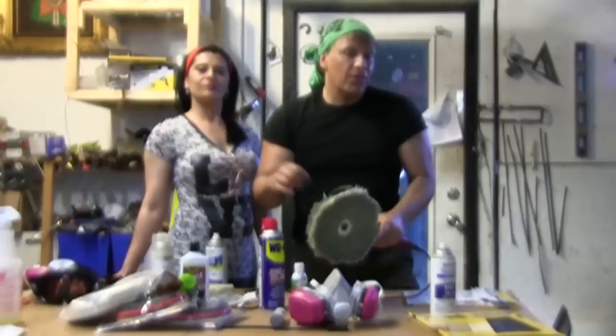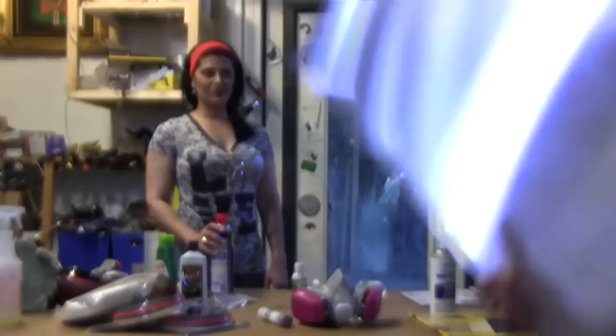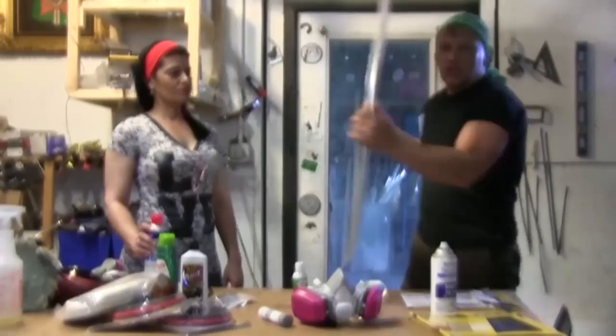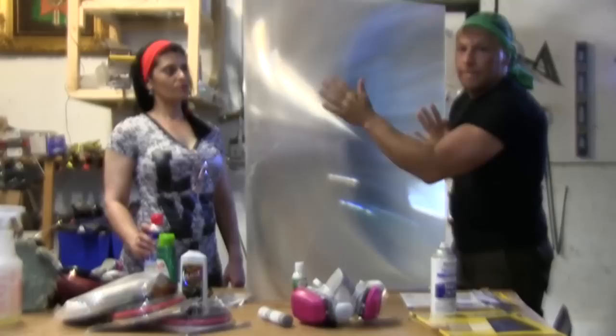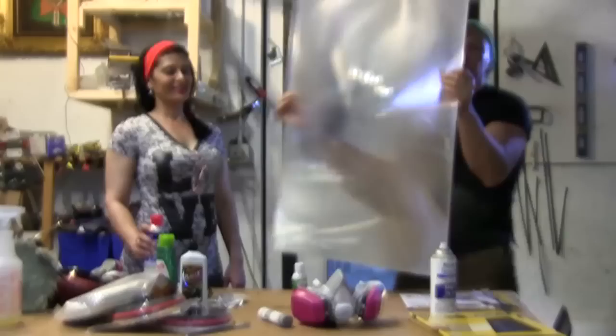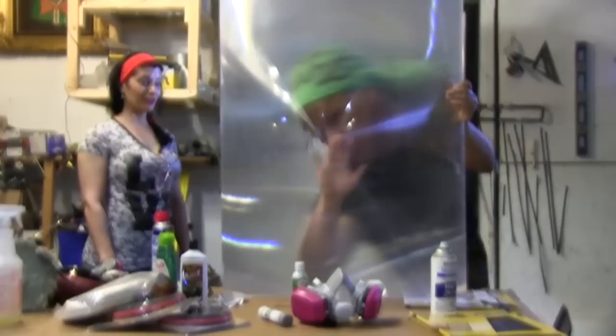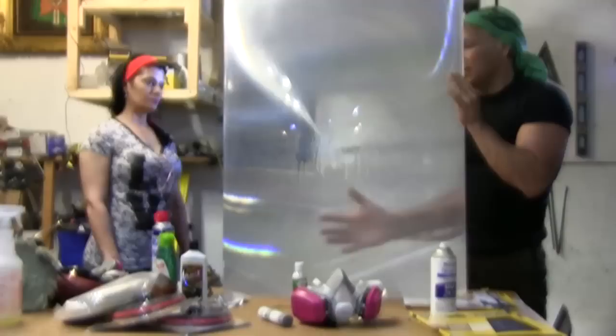A simple test you can do to see if a linear lens can be converted into a spot is to put a little oil on the front side. We're going to be using WD-40. This is a linear lens and I have the Fresnel rings facing the camera. You do not want to spray oil on this side because it will take a lot to get it out. On the smooth side of the lens, we're going to take a little bit of WD-40, spray it on there, and then rub it around with your fingers. This area here is linear, and then when we come here, this area has a spot to it.